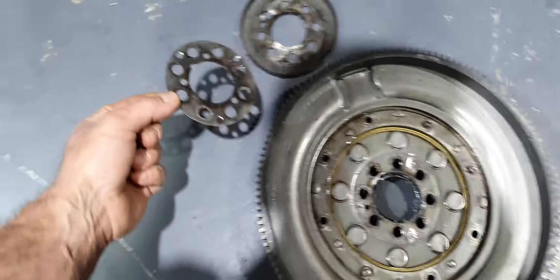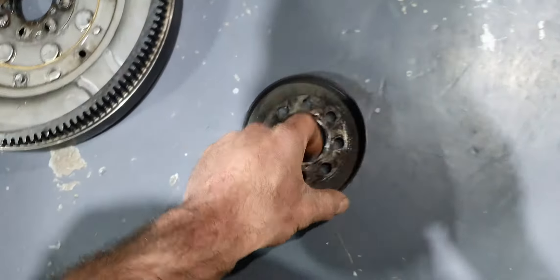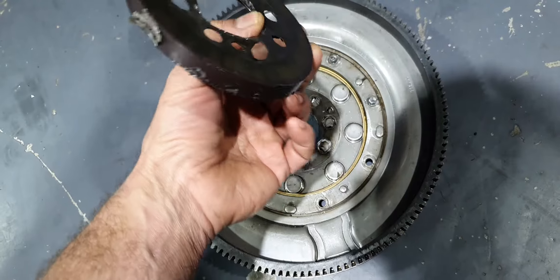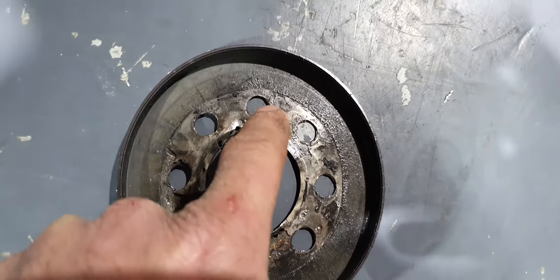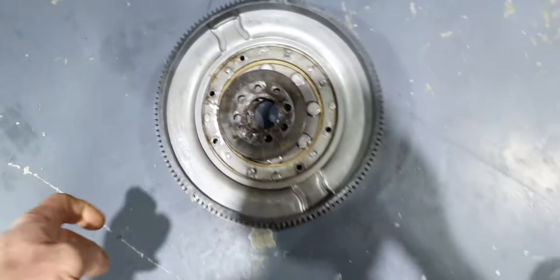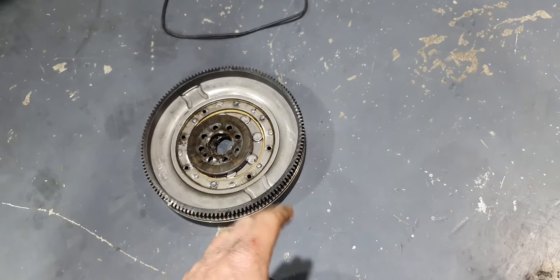My theory — I don't want to blame anybody — I'm just saying one scenario. You see the washer, you see the reading wheel that reads the crankshaft position sensor. You see the thin washer that comes apart, and you see the holes that became like an egg inside. So first he melted the spark plug on number two cylinder, and then came the sound. My question is: what if, when he was pushing the car — keep in mind it's heavily tuned — the reading plate started playing?